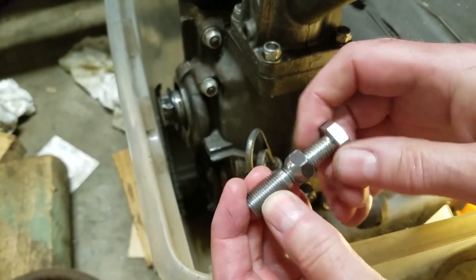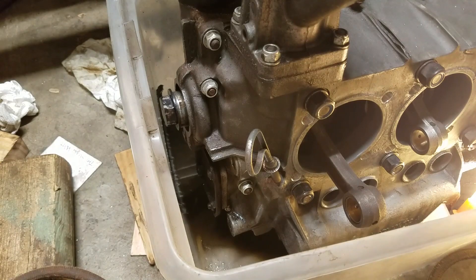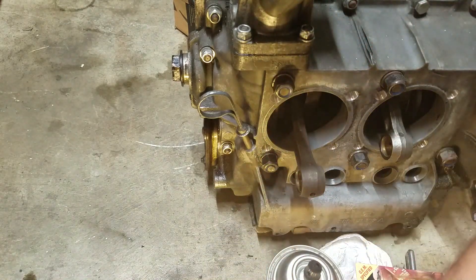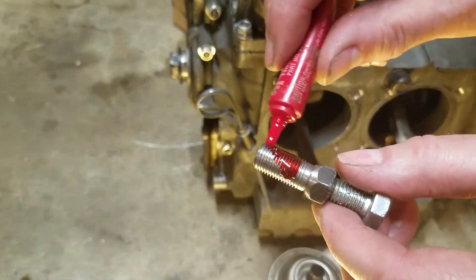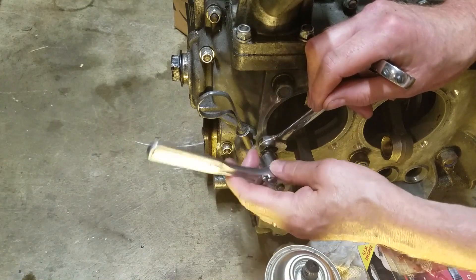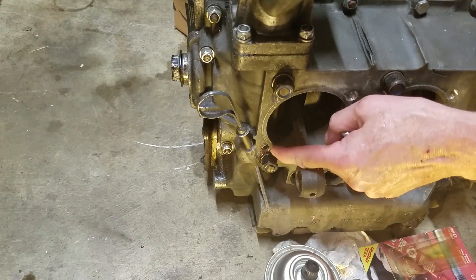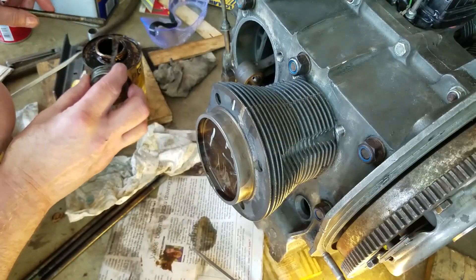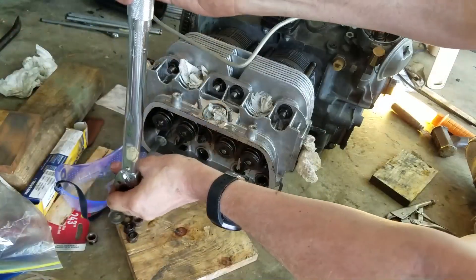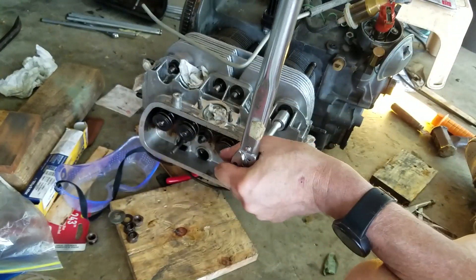Now it's time to install the case savers. I have a 10mm bolt and an old stud nut that I had ground down to a smaller diameter than the case saver. I use a little red high-strength, high-temperature Loctite on the outside of the case saver and drive it home, stopping when the case saver is just below the surface of the cylinder base so it won't interfere with installing the cylinder. I do this for all 16 case savers, then let the Loctite set up for a day. When I install the studs, I use a little sealant on the threads to stop oil from leaking — something similar to Aviation Permatex. When I reinstalled the heads, I was really happy that the head nuts torqued right up to the specified value without any stretching. Things were looking up.